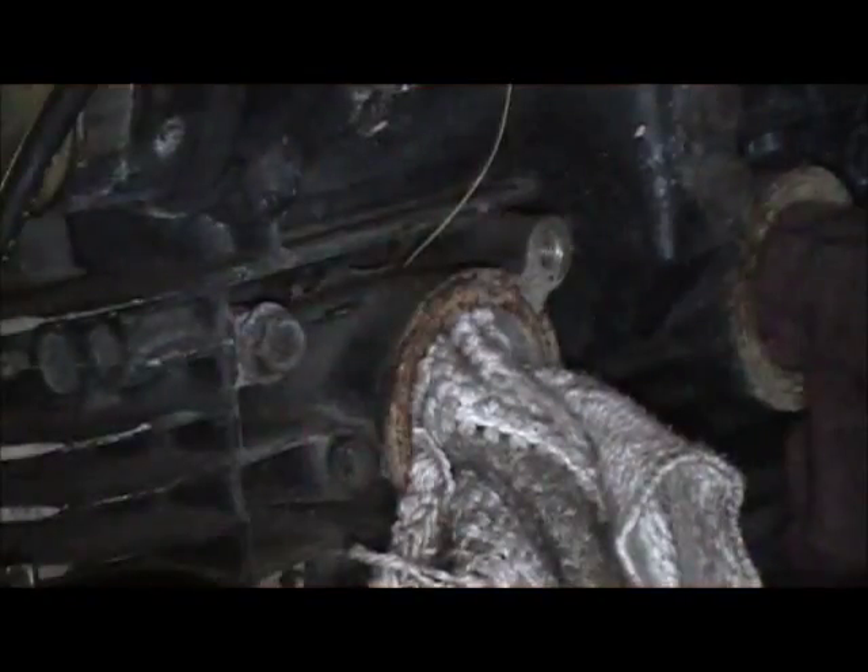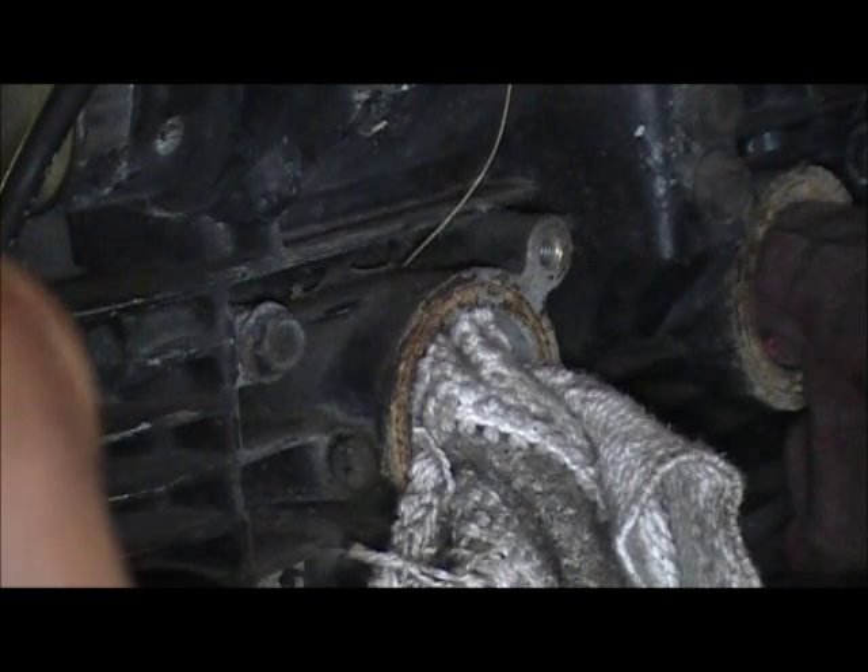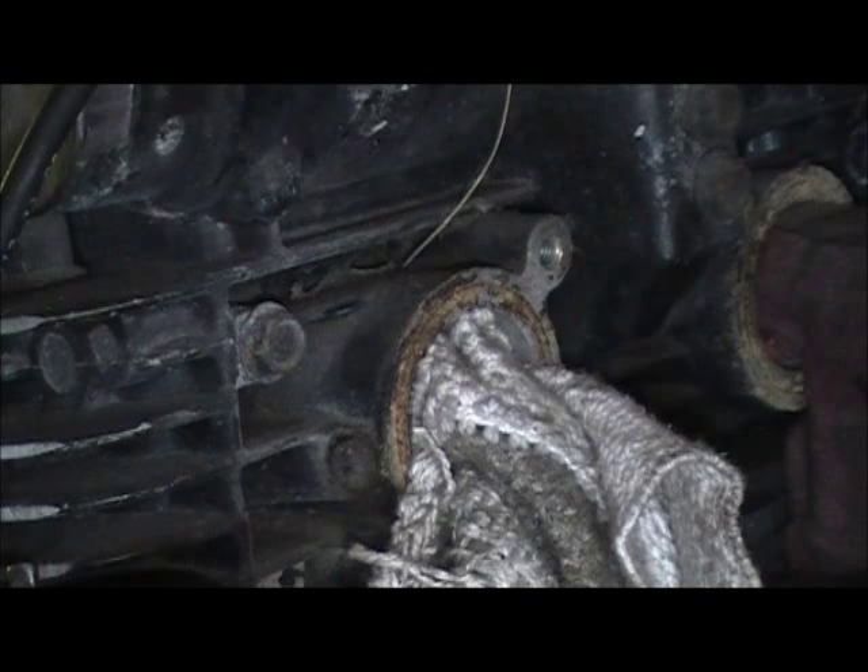They're not new-new, but this is what came off of this bike. This is some nasty shit. That little air leak right there is enough to fuck up the piston — you get it running too lean, too hot, knock a hole in the top of your piston.